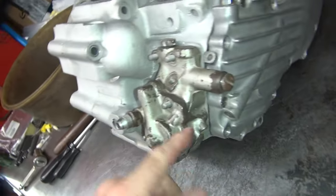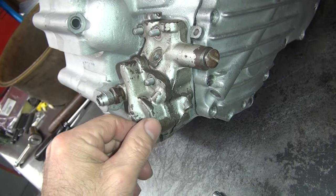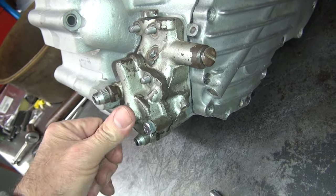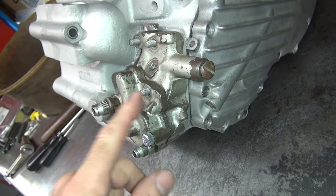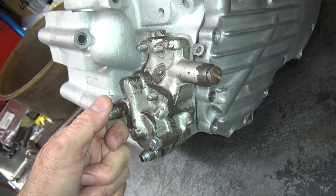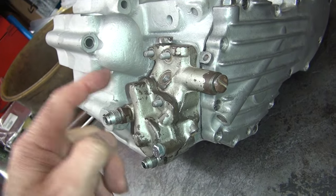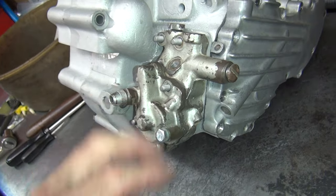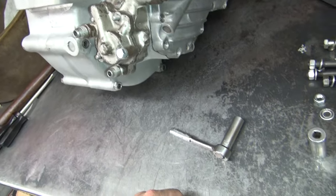The intermediate plate — I didn't have any on the Harley shelf without the holes. I had three brand new ones with the holes in them, but not the ones without, because those are the ones they wouldn't sell anymore. So I'm going to probably weld those holes up. I'll get the instructions, but I'm pretty sure they just fill up these two holes — this one and this one up here. I think this is the feed hole, the one that really matters, but both probably block it off completely and keep the oil from filling up.